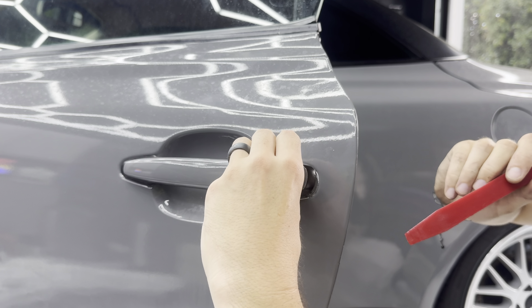To remove this hood trim piece, there are five little bolts. For the front bumper, you're going to have two clips here as well as two clips on the other side underneath the fender liner. This liner is cracked so I'm going to be replacing it, but you have to remove the fender liner and then you'll see the clips up there.